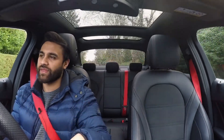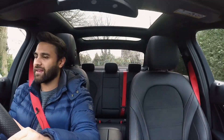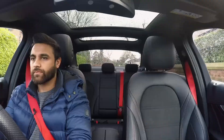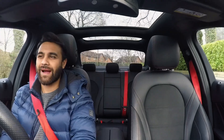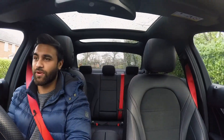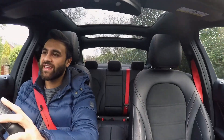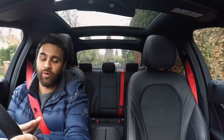In a car like this with a performance exhaust button, you can keep everything quite tame, and in the louder exhaust modes the flaps stay open for longer - you can control it with a button. But generally between zero and three thousand RPM the flaps will only ever open to about 70%, even if you accelerate hard. With this exhaust module, it bypasses that and leaves them open at 100% from zero RPM onwards. This isn't specific to a C43 - you can do this with many different types of cars so long as you've got a valvetronic exhaust system with a performance exhaust button.